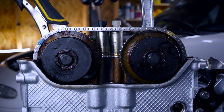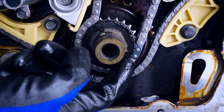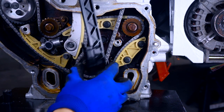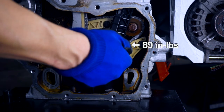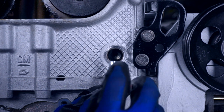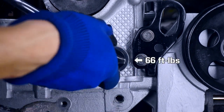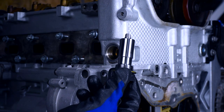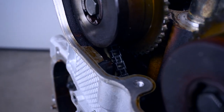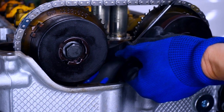That was a little bit fiddly but we finally got the timing marks properly set on the intake and exhaust cam sprocket actuators. Down here on the crank sprocket there is a little dot that is the timing mark, and the dark link on the chain is lined up with it. Now let's install the left-hand guide and use the last of our ZZP guide bolts. Now let's install the ZZ Performance timing chain bolt — it replaces the timing chain guide bolt and the cap, all integrated into one bolt. Notice that this part goes into the timing chain guide. Here's our new timing chain tensioner. I'm going to use a rubber-handled screwdriver and press it against the tensioner, then tap it with a rubber mallet to compress it at least one eighth of an inch. And now the timing chain is tight.